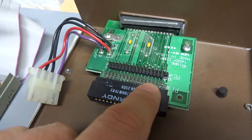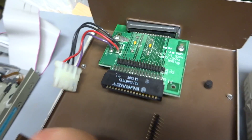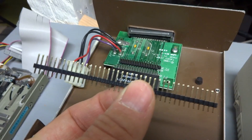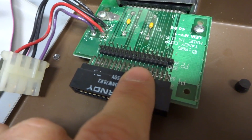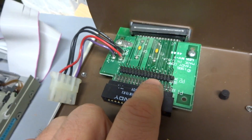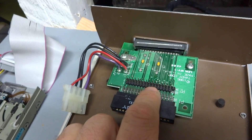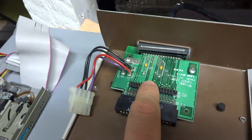When I took the drive apart, I noticed there were holes on this board for a pin header. What you do is take some pin headers like this, which I have in my tool kit, break it in half, and you essentially take this board out and solder it on. This board is sort of universal and made to either run a 5.25 inch drive, or a 3.5 inch through these pin headers.